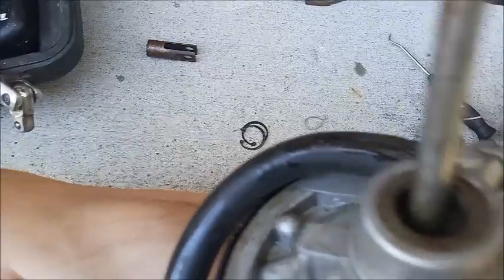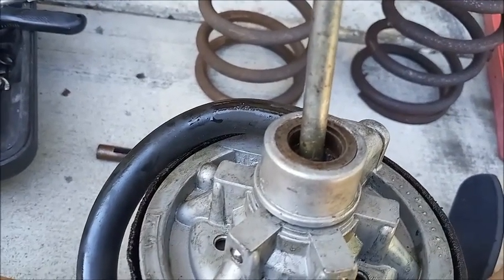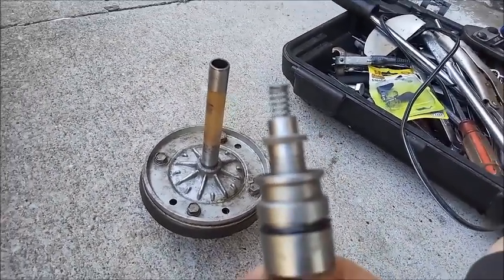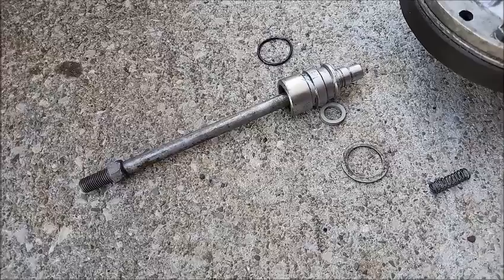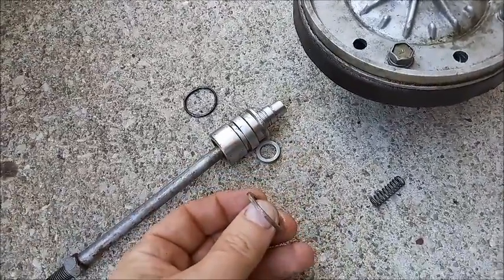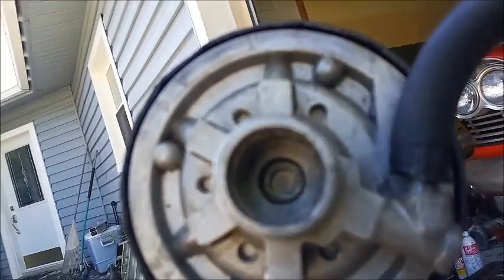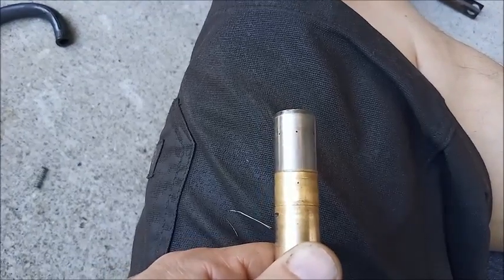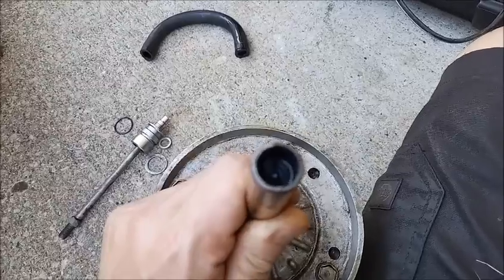With the snap rings removed, I'm going to turn it the other direction, holding on to the rod so that the parts that are internal won't just fall out. So this is what came out. This is a bit improvised. I'll explain later why there's all these washers instead of what's normally there. So this is the air valve with its O-ring gasket. This washer's at the end, just before the snap rings. The spring, and they fit up inside there to operate the booster when applying the brakes. Little holes in the plunger. Fluid is able to pass through those holes when the brakes are released.